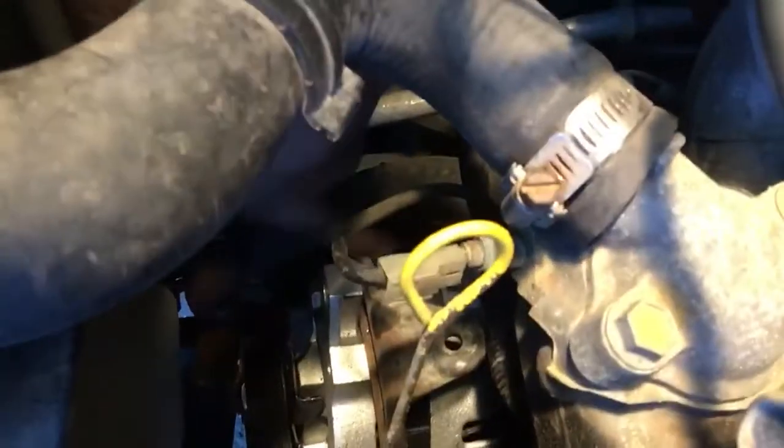This bracket right here, there's the adjuster. Just loosened it, flipped it out of the way. I used a little bungee cord to hold it up while I flipped, to keep it from falling back in the way. Everything else is pretty self-explanatory as far as the removal or installation. There's a bottom pivot bolt down there. You can see the bracket right there. It's pretty easy to swap out from the factory one. This is a low range off-road GM alternator bracket.